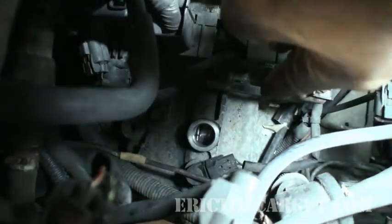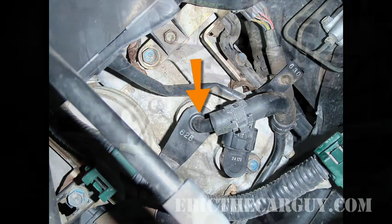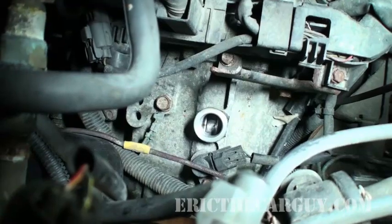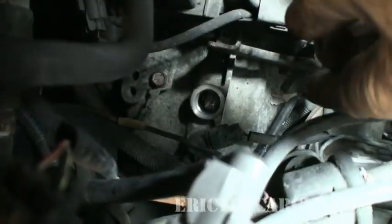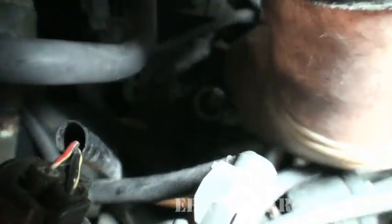Some of these — especially TLs — may have a funky little tube going into the top of the transmission. That's from a campaign from Acura and Honda: what you're looking at through that hole is second gear, and they ran a cooling line into the top. To remove it, there should be a little 10-millimeter fastener nearby — take that out and pull the whole tube assembly out. It sits in the same position as the fill plug, on top of the transmission.